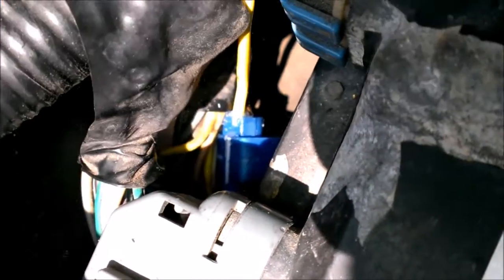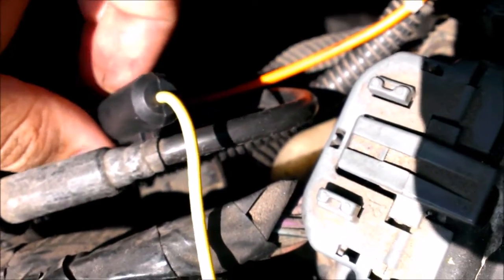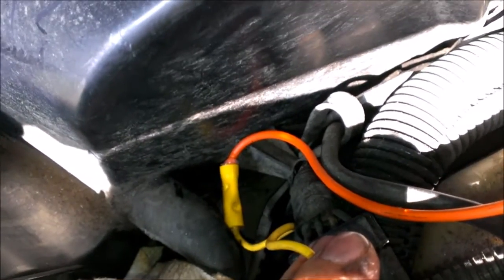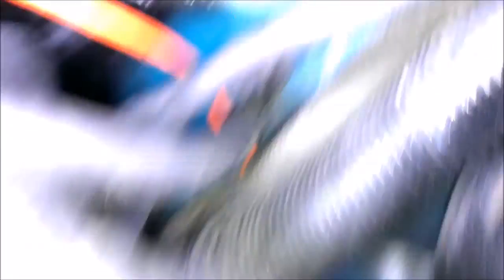I just scotch locked it — wire tied it with one of those quick connectors — and put a bunch of dielectric grease on both ends. I got it fused. It's a 2 amp at 250 volt, but I probably should have used something like a 7 amp at 125 volts — probably better. There's one of the butt connectors down there, dielectric greased on both sides. The wire runs all the way over here and I poked a real tiny hole into the steering shaft boot. Everywhere else you've got something going on — you can't get a wire through it.